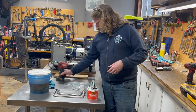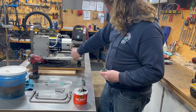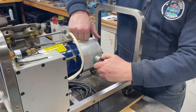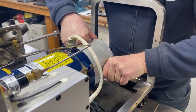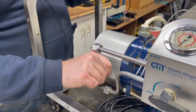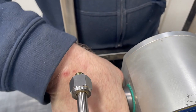Now we've got these together — I've got the piston bottom on — and I'm going to install my cylinder into the machine. I'm just going to push and twist; I'm not going to force it because I don't want to damage that o-ring seal. Then I'm going to do the same thing on the opposite side. Just carefully put it in there.